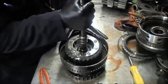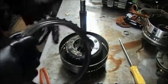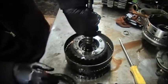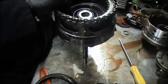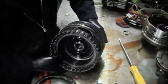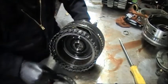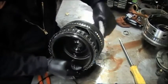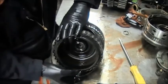The transmission is like a puzzle — if you put something in the wrong way it won't go. This is the ring gear — actually it's the pressure plate, excuse me. You put that inside and then put the snap ring around it, and the snap ring along with the pressure plate will make sure the shell does not fall down and stays stuck to the K2 drum. Put it inside and the snap ring will hold everything together.